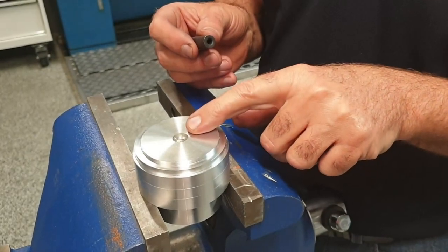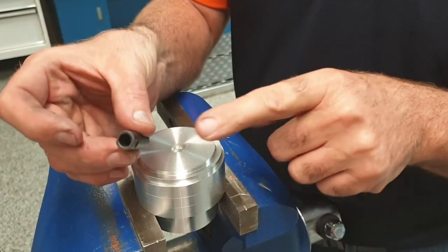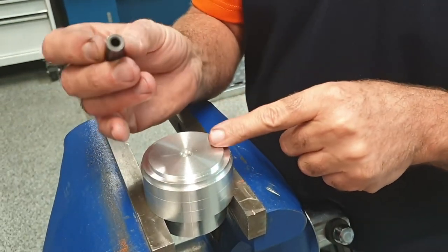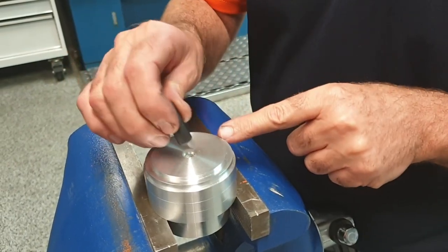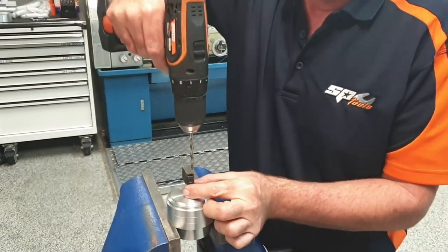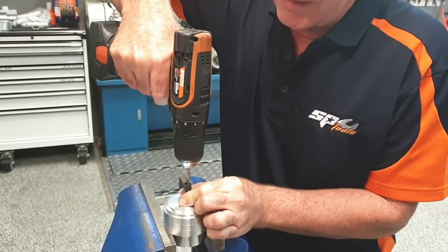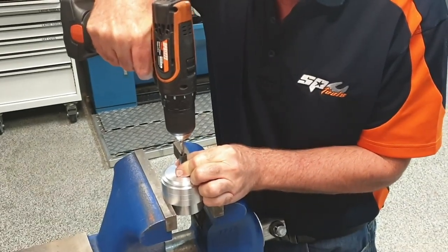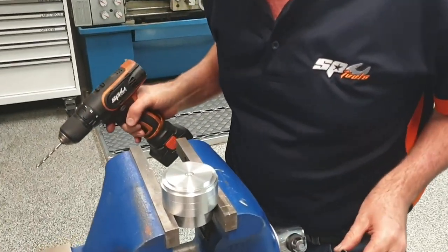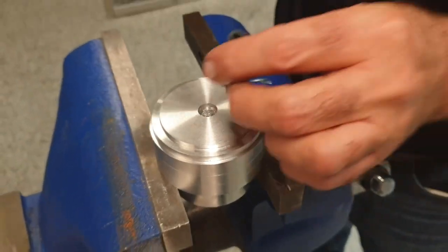This time we're going to have a go at removing a stud that's been broken off below the surface. We select the correct guide — you can see how the guides are bigger on one end and the drill size is on the other. We want this to be as central as possible, so we put the smallest hole as close as we can to the bolt and drill through. It's not a particularly flat surface to start with, but checking the indentation from the tip of the drill it looks to be pretty much in the center, so we'll continue.